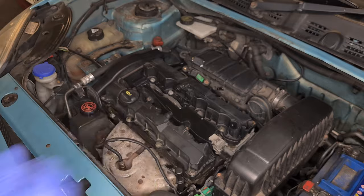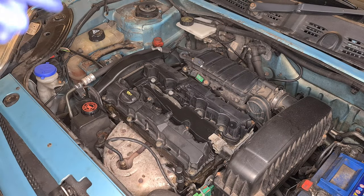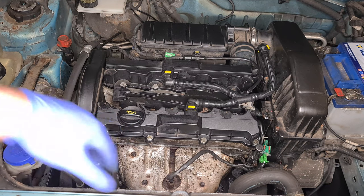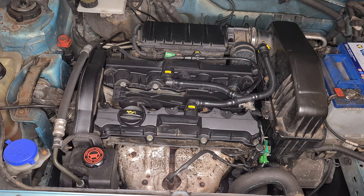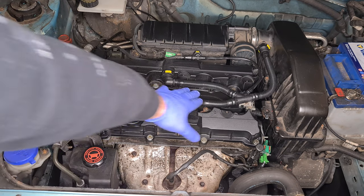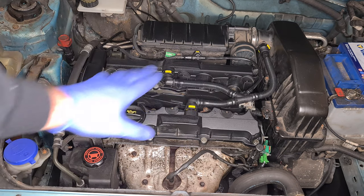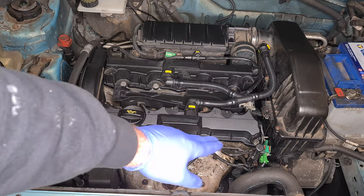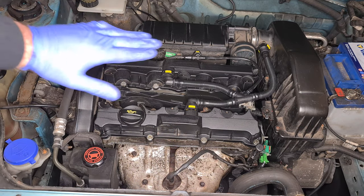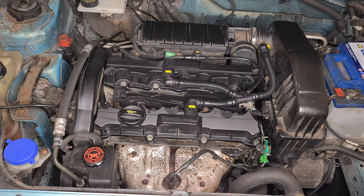That's pass one complete. I'm just going to go over them again now and get the back one done. So that's all the bolts torqued up to 8 Nm. Went over them again in that sequence. They're all fine. None had gone a little bit slack or anything as the gasket compressed. I put the beautiful new pipe on, cleaned everything up, and also cleaned the best I can around where the gaskets were weeping before. So I'm going to finish up now by putting that spark plug cover back on, and then I think we're pretty much done for the day.